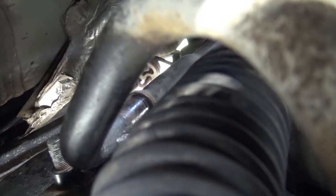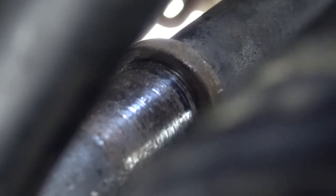There's a little collar on the sway bar - the rubber bushing goes on the outside of that collar. That collar is designed to stop the sway bar from moving side to side too much. You can see the worn out area - that's where the bushing is going to go, and that's towards the outside of the vehicle, towards the wheel. So that's where you put both rubber bushings.